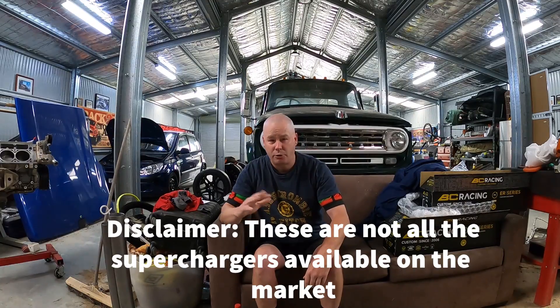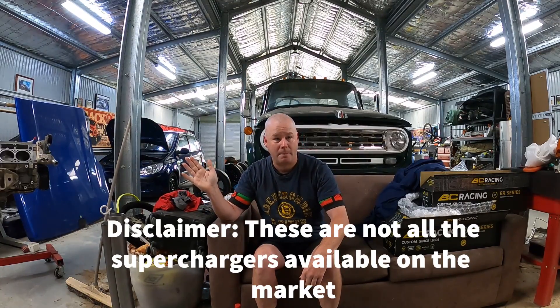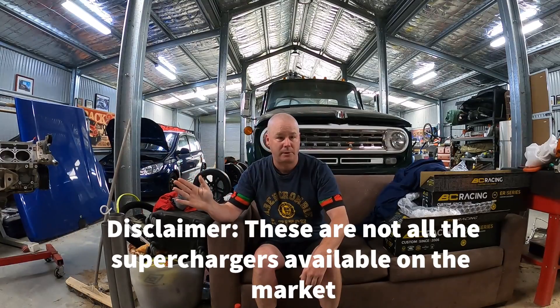I've got all the links in the description below for all these different manufacturers. We've had personal experience with the two Harrop items. Sort of power increase on a bolt-on, either 6 litre or 6.2, anywhere between 450 up to 500 rear wheel kilowatts with a positive displacement blower. And that's obviously with the tune and all the other mods we've been talking about, but not necessarily a cam or heads. These top mount blowers are pretty reliable, and a lot of them come with big warranties as well. For the ones we've had, we've had no dramas.